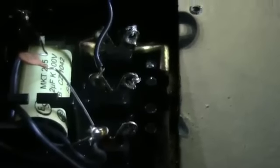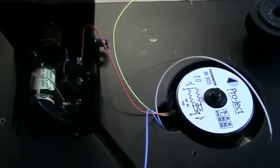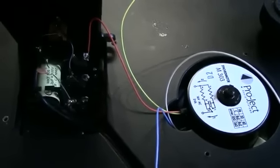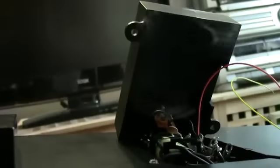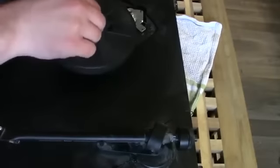Here we have the three ears of the power unit that we're going to attach our wires to. You might want to clean these up a little bit, but as long as you've got a little loop to feed the wire through you should be fine. I've now put the new motor in and starting with the back wire I've looped it around the little eyehole, ready to solder in place. Now we piece it all back together.